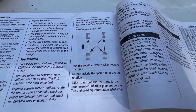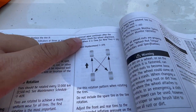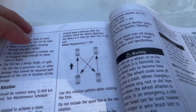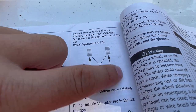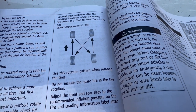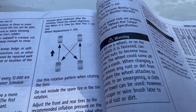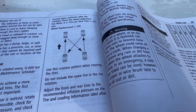So this is the order that you need to rotate your tires if you've never done a tire rotation before. This arrow is indicating towards the front of the vehicle. You jack your vehicle up, use jack stands — whatever you've got to do to make sure everything is supported. The front tires you crisscross when you bring them to the back, and then the rear tires just go straight forward. You follow that process every time, and that is supposed to ensure even wear and maximize the life of your tires. I've already done that part — had to shower because it's super hot here already, even though it's 9 o'clock in the morning.